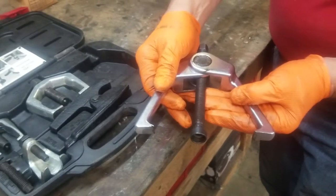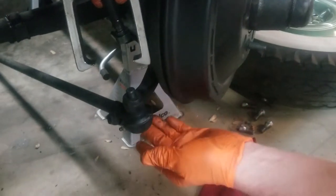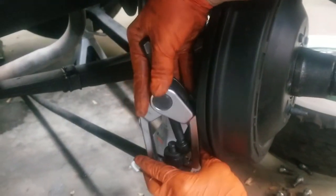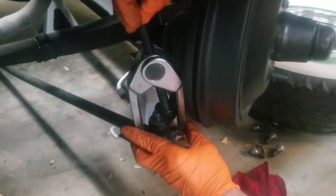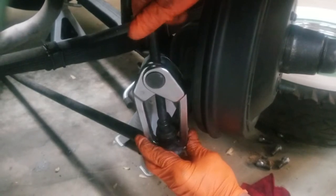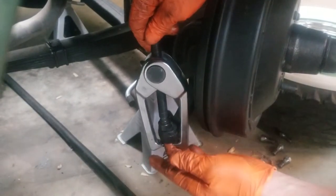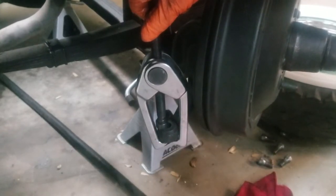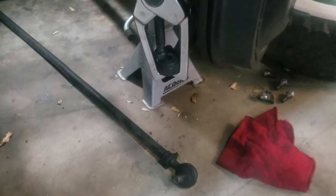We're going to use this device to pull the tie rod. With your tie rod end puller, you're going to take the two little feet and set them under the knuckle where the tie rod is fastened. Set this portion over the threads and bring it down tight. Since I've already undone this once, I'm going to show you how it's set up. When it's tight, you're going to use your impact gun on the top — on forward, it presses down on top and pulls up on the fitting, popping it out.